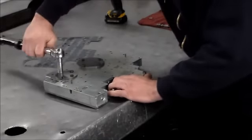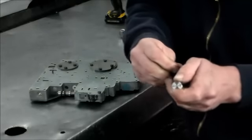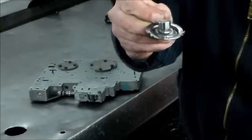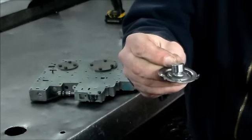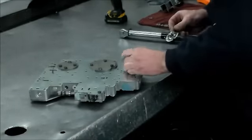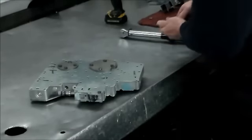Now with this plate, this is that top piece to that 2-3 accumulator. There's a piece I call a sombrero, and here is the other piece that's going to sit like that to keep that plate from cracking. As the accumulator constantly works, it will not bang a hole in the plate.